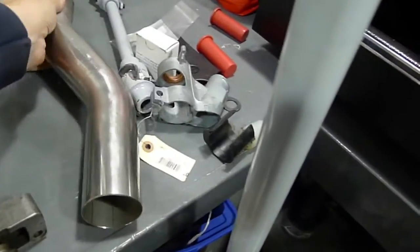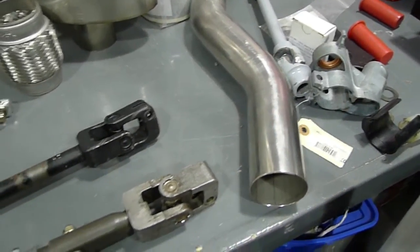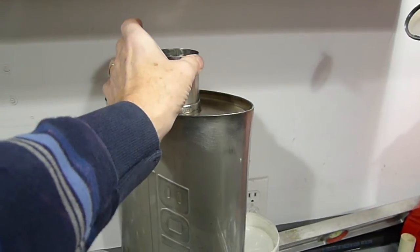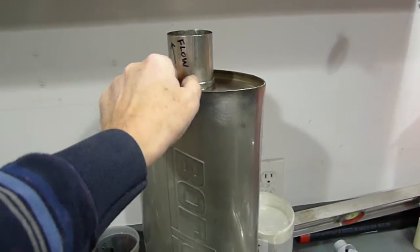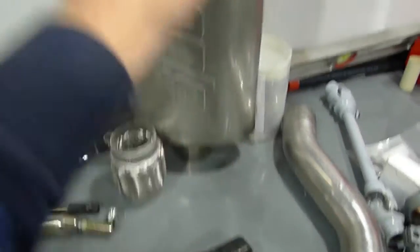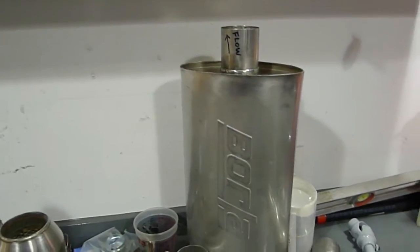It wasn't quite right — these two lines should be exactly parallel and they're off by 5 degrees. Anyway, this slips inside this. So this is 2¼-inch OD and this is 2¼-inch ID. I've now got 2½-inch OD, which is 2⅜-inch ID, which will slip over this snug. Then I can weld this on. So I'll make the 2½-inch tailpipe. The 2¼-inch goes inside here, and the outside of this slips in there — so it goes slightly larger as it gets to the very end of the car, which is going to be fine.